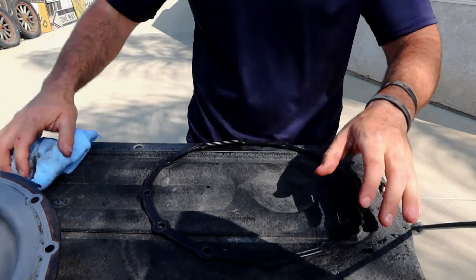A few moments later. Reassembly is pretty simple. Basically the gasket can only go on one way — you got all the bolt holes to line up, and then you're gonna take some of your Loctite. This is the gel, I've never used it before — just put a little bit around each bolt. I like to wipe it clean one more time because if you let it sit, oil's gonna seep out and you don't want oil right where it seals. So you want that clean, then you put it on, and that way you can get a nice seal.